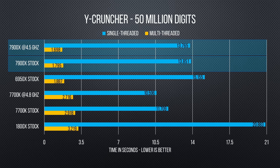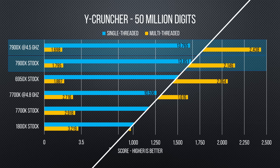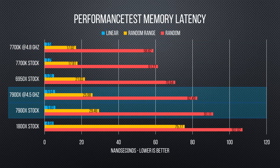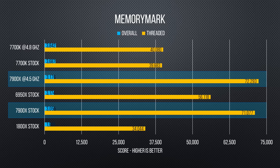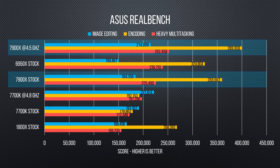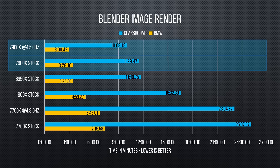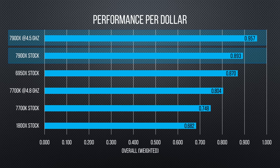As for productivity — this is cool. One interesting aspect of Skylake X's design is that it moves from relying heavily on a ton of level 3 cache to relying more on its higher-speed level 2 cache. Where Broadwell-E had 256 kilobytes of level 2 per core, Skylake X has a whopping 1 MB each. The level 3 becomes what's known as a victim cache, leaving the most relevant cached data in the fastest cache more often, which results in some of the performance gains we're seeing here.